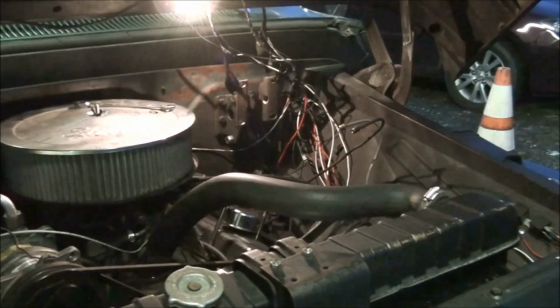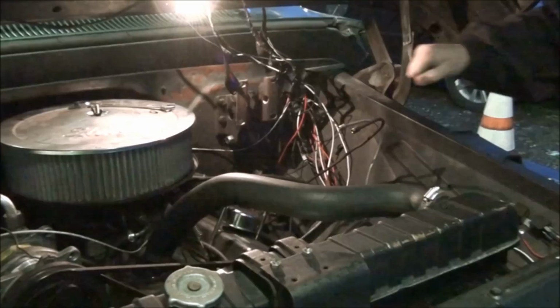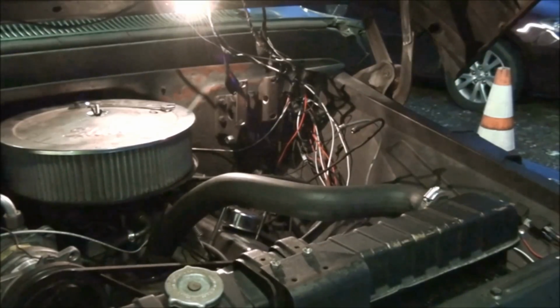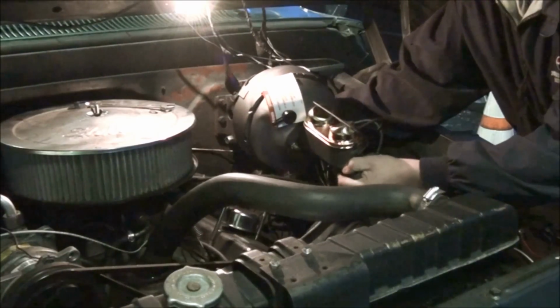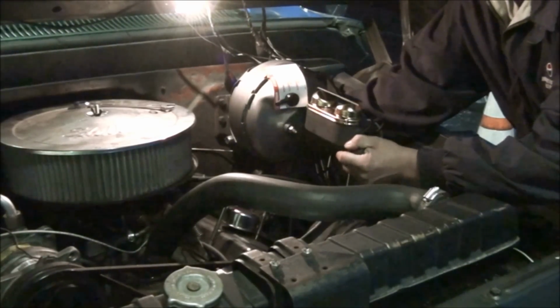Well, when you pump a master cylinder, it pushes fluid out, it sucks back. It pushes and it sucks. So the worst thing could be is air is just a little bit in the end of those lines. It'll suck it back into the master cylinder. It will work its way out if I keep fiddling with it. And that's what I'm planning on doing because there's no air down in the system, so it can't go any further. Somebody can and will argue with me on that point. I know they will, and that's just how it goes.